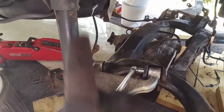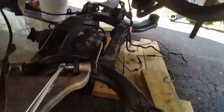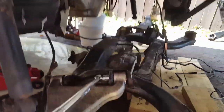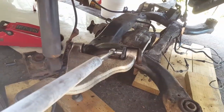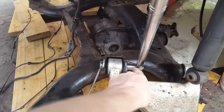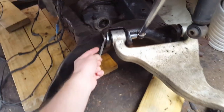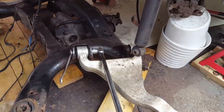On the driver's side it's a little trickier because you have to turn the nut in the opposite direction compared to the passenger side where I can push down with my foot on the breaker bar. Because this whole thing is now loose, the whole thing shifts when you're trying to break it. I had to grab a cheater bar, put my foot here to hold it in place, and then I was able to pop the nut. So the driver's side is trickier, but you should be able to do it with a long breaker bar. With both my 17 socket and 17 wrench, the wrench acts as leverage against the frame itself while the socket slowly turns the nut out.